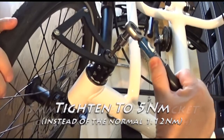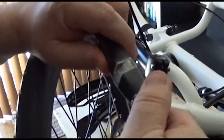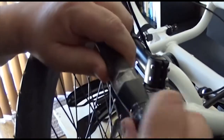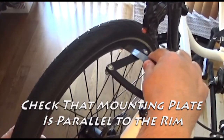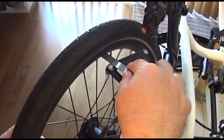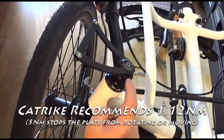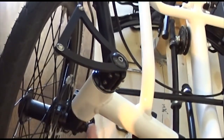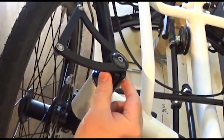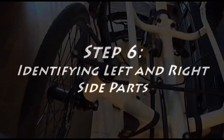Set your torque wrench to 5 newton meters and keep pulling until it goes click. After you're finished using your torque wrench make sure you dial it back — there's no better way to damage a good torque wrench than to leave it tight. Now that you've torqued it up to the correct standards it's time to double check to make sure the plate is still parallel with the rim. Next just turn the wheel from side to side and make sure everything is still nice and loose. When we tightened up the top cap it's well beyond Catrike's normal standards, but since the stem bolts are tightened up that stops the whole headset assembly from falling out and also stops the cap from pushing the stem section downwards.